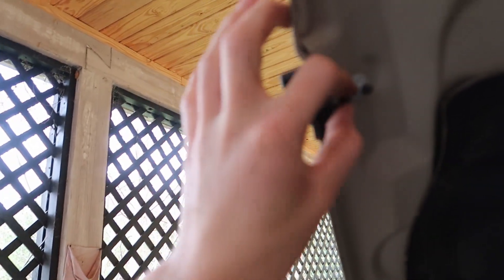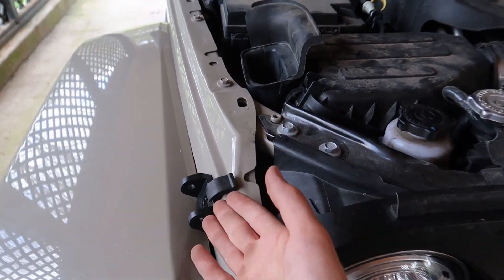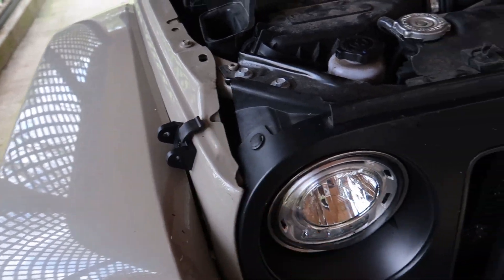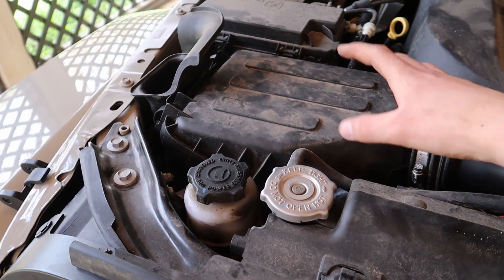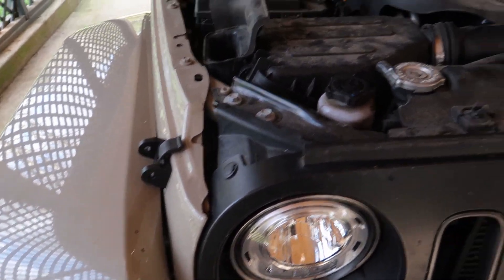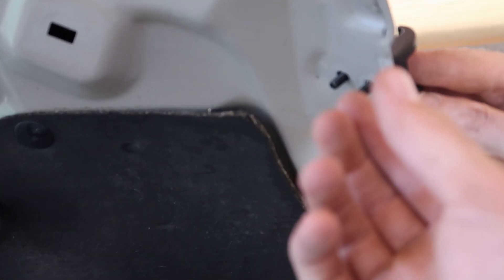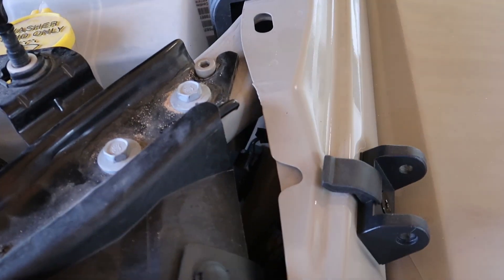Now we just have these top ones to do, which are actually pretty simple because you can grab the whole thing. When we were initially trying to figure out the best way to take the original one off, we were trying to go through here like we did the first one. We looked at this aero fairing and tried to take it off — do not do that, it will not help you. It's easiest to just go up through that inner fender and get it from the bottom. You don't need to remove that aero fairing. Here's the new hood latch installed; just tighten up on these bolts right here.